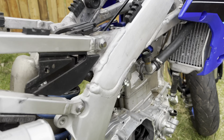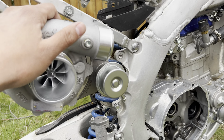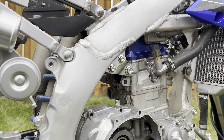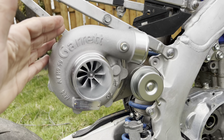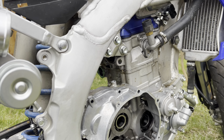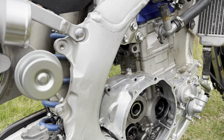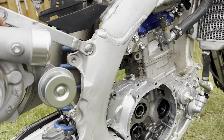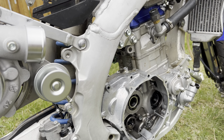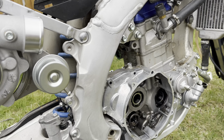This turbo has a longer hot side, and that has a big bearing on how far you can push one of these turbos because of the exhaust pulses a single cylinder creates. That's a whole other subject - I'll make another video on it because there's a lot of science that goes into turboing a single cylinder. You basically throw out everything you know turbocharger-wise from a multi-cylinder engine because it's a lot different with single cylinder.